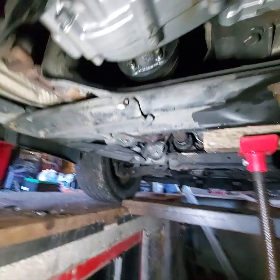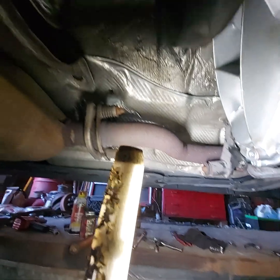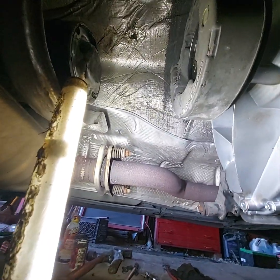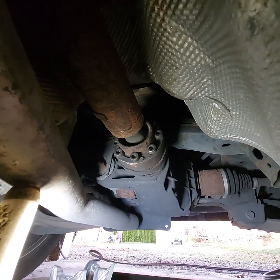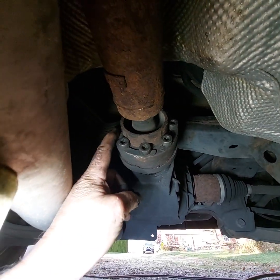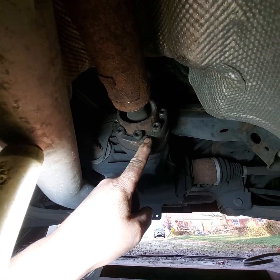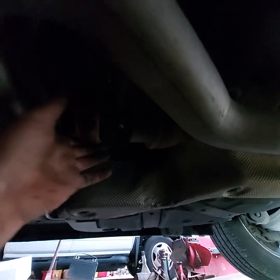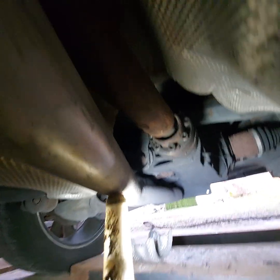And obviously I tightened that rear yoke on the front drive shaft. I can go ahead and slide the drive shaft forward, get it up in here and get those 6 bolts put in. Okay, I got the rear joint in. I got to get 2 more bolts in it, but I'm going to start it up and back it up, bring them down here to the bottom, and I'll get them in because the exhaust is kind of in the way. Just make it a little easier. And also leave your carrier bearing unfastened, and that gives you a little bit more room at the top to work on getting your bolts in.